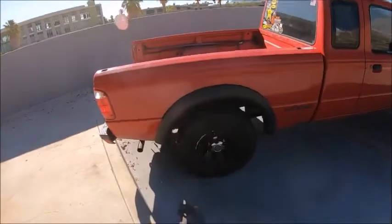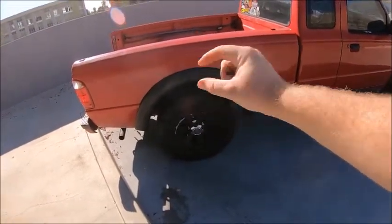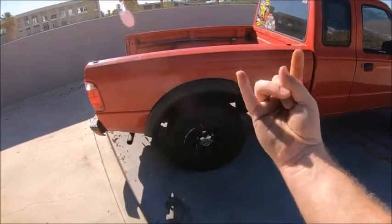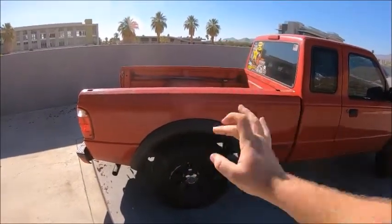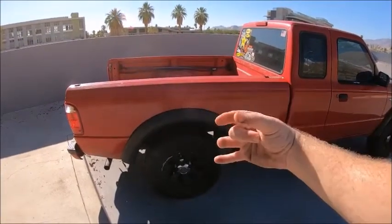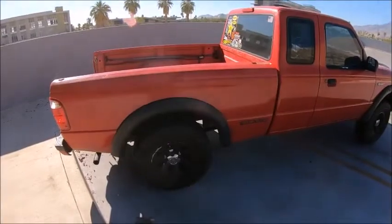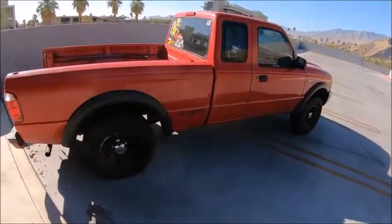Back end, the 2-inch lifting blocks, the U-bolts are 1/2 inch diameter by 2 7/8 between the two prongs that go up where the bolts go, by 9 inch long. Now you're gonna get this 1/2 inch thick by 2 7/8 by 7 inch long for the new U-bolts on the Ford Rangers and stuff, the Mazda pickup truck, stuff like that. So those are the measurements.